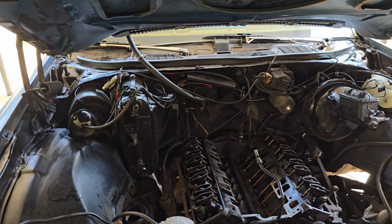So I just got done cleaning up all the surfaces for gaskets, vacuumed everything out really good, and it's time. My intake and everything should still be clean from last time on the bottom. I want to clean my valve covers with some steel wool before they go on. So as you can see, we got all my gaskets, I hope, got Permatex. I might go around the water ports with just a tiny bit on the intake like that everybody else does. And I'm probably not going to use the rubber pieces for gasket. We're going to make our own. By doing so, I'll probably have to let the car sit a little longer to set up, but it's hot enough outside, that won't take long.